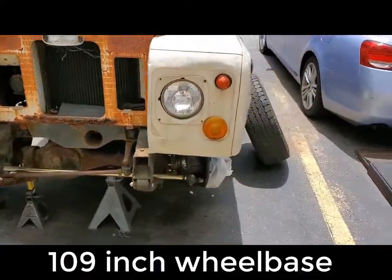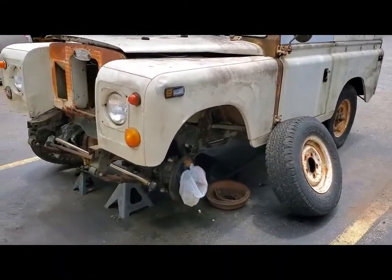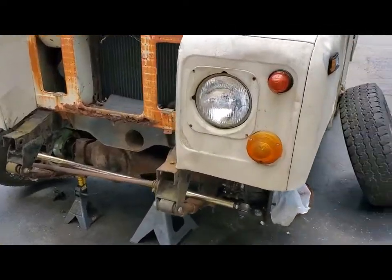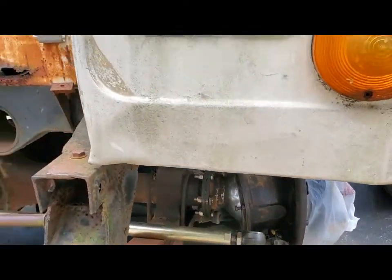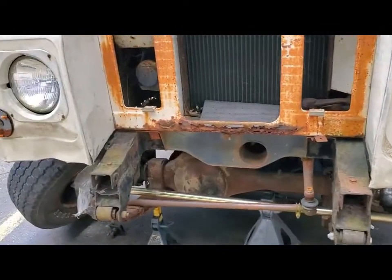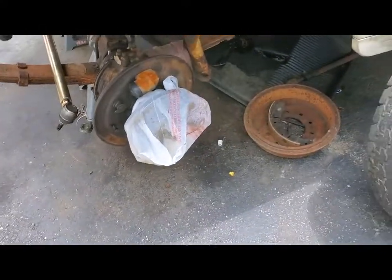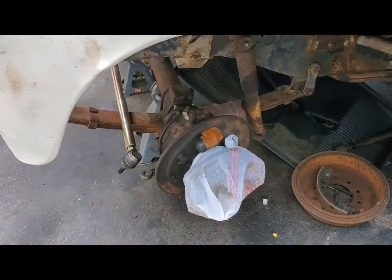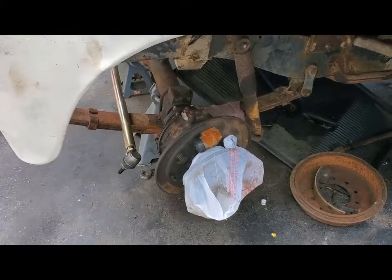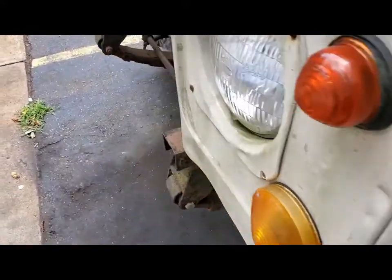This particular vehicle is an 88, so I had to modify the front hubs and everything to accept different steering arms. Now my latest problem is that the 109 brakes are different from the original 88 brakes — there are two cylinders as opposed to one. They're really better brakes, probably, but they don't exactly work on here.